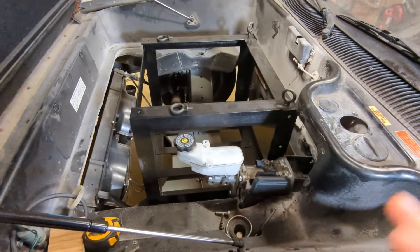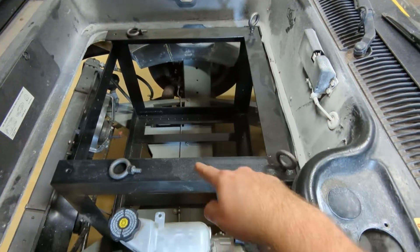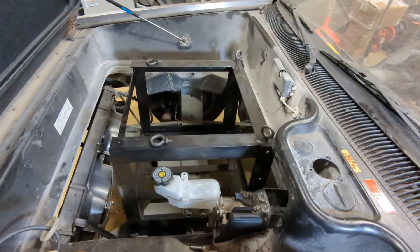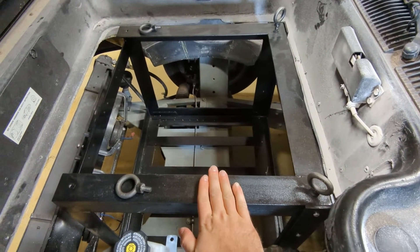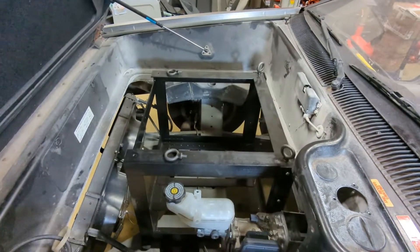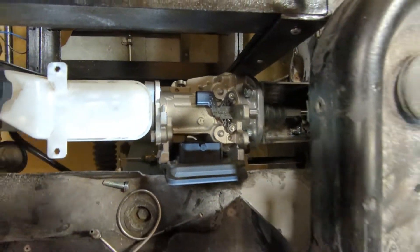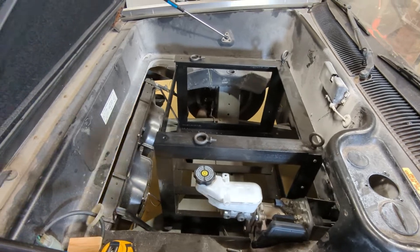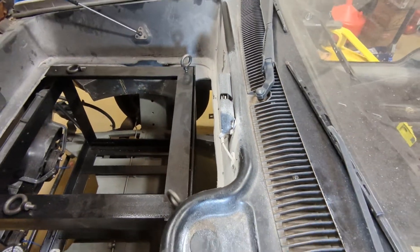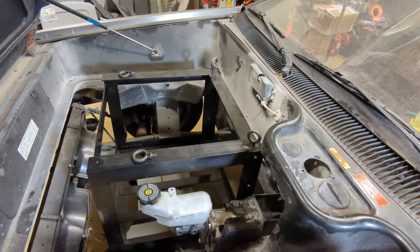Before I jump into mounting the battery box, let me show you where it's sitting and why. This main structural beam running right down here is our front cross member — very strong, very sturdy. It's basically the front of the Y-frame, or X-frame, as they call it on a DeLorean. This is where all the weight for the front battery pack is going to be resting. I've got the battery pack positioned just a little bit farther to the right than perfectly centered because I needed to make room for our brake booster and brake master cylinder. I also went back as far as I could while still maintaining space behind here for high voltage cables, cooling pipes, and likely the HVAC stuff coming through this front area.